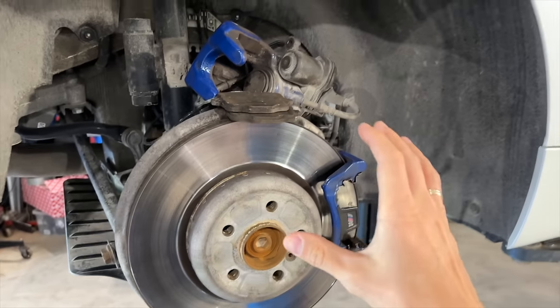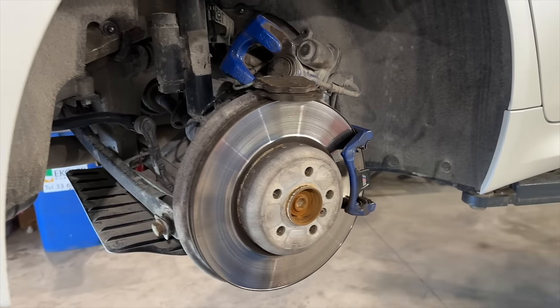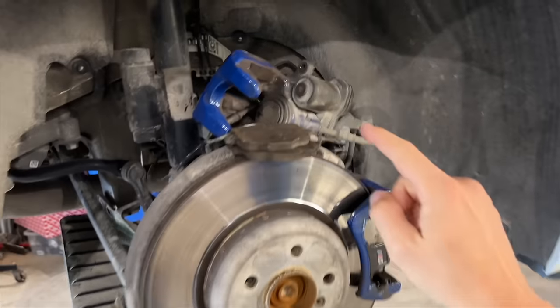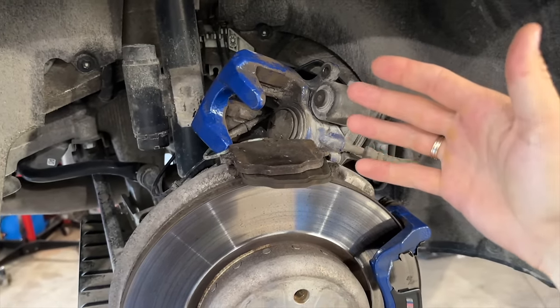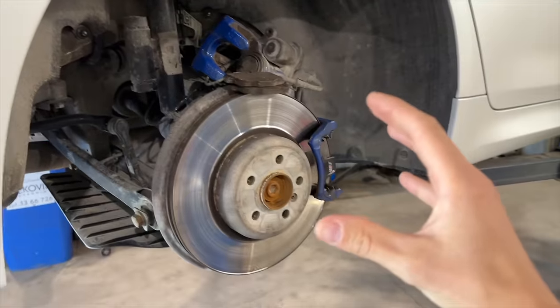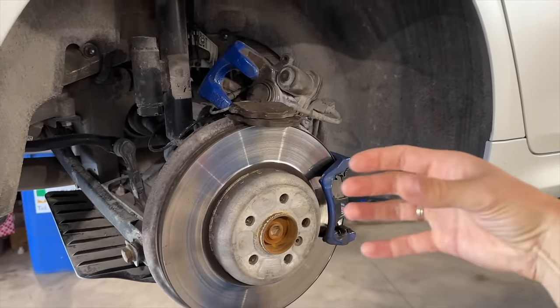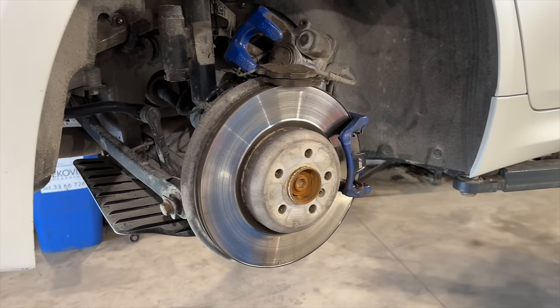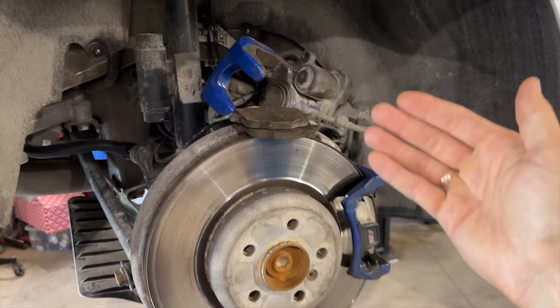On the F-Series, for example, on the F10, on the 5, and on the 7-Series F01, there is also the parking brake. It is electrical. And over there, you need to use a special function in ISTA to open it up. Otherwise, you'll be unable to disassemble and assemble the brake system properly. On the G-Series, it is not needed.